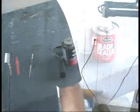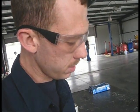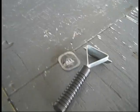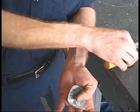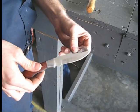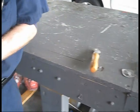Can we just put it on? This scrapes the tire to have a smoother surface so the patch can go on easier. And one more piece, we use this, it rubs on the patch. And whenever I put a patch on, I take my knife and pull the seal up a little bit, because some of these seals are so hard to get up that you'll end up pulling the patch off. So before I do it, I just lift a little, like that, so I can get something to grip on.